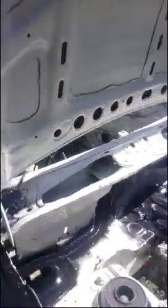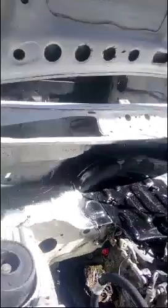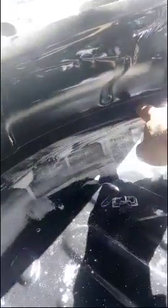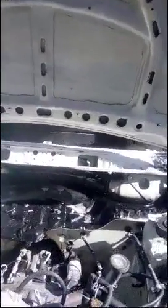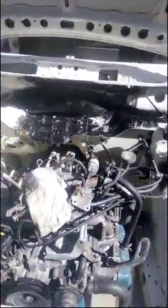The second worst spot: these cars have the spare tire sitting on top of the engine. There's a seam that runs across the top of the firewall, and once the seam sealant goes on that one, it tends to get rusty in there. Again, this car is extremely good — there was only about an inch or so that needed attention. Scrape off all the seam sealer, put on rust-converting acid, sandblast any scaly parts, then paint it and it's good. I'm going to pull this engine out of this one soon.